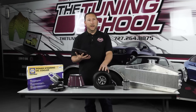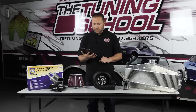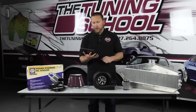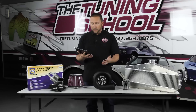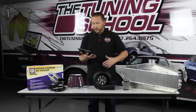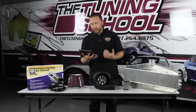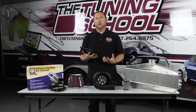If we're talking about the D1 like we have here — the D1SC, the original blower — it would make about 1,400 CFM, which is a lot more airflow, and it originally supported about 925 horsepower. The new one, the D1X, because of the new impeller design and the new Volute design, actually flows 1,500 CFM, which is a lot of CFM, and also supports about 1,000 max horsepower.